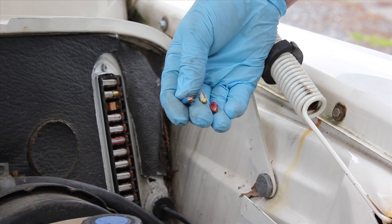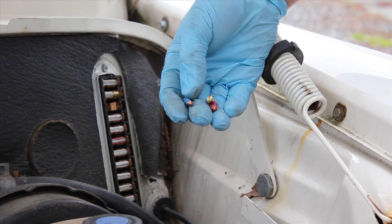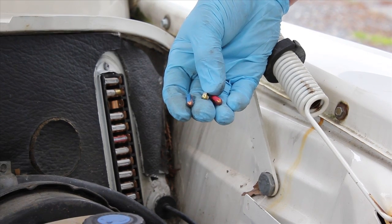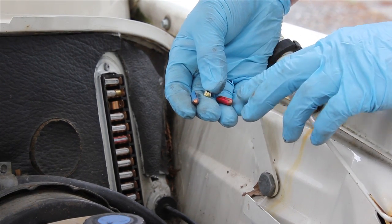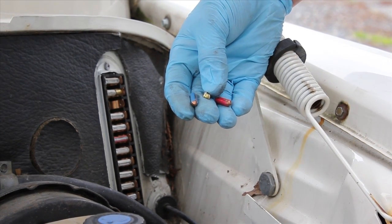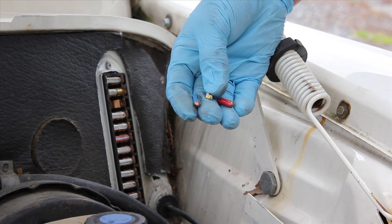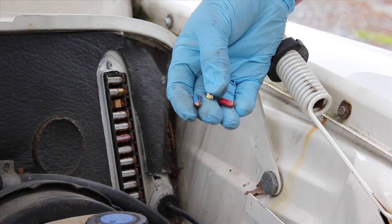We offer a simple solution on my website. This is probably one of the cheapest repairs that you can make to a newly acquired Mercedes. Note that these replacement fuses are made from a brass copper alloy, and when you install these in the holders, you will in essence prevent future corrosion problems.